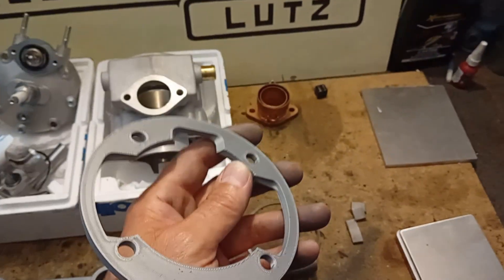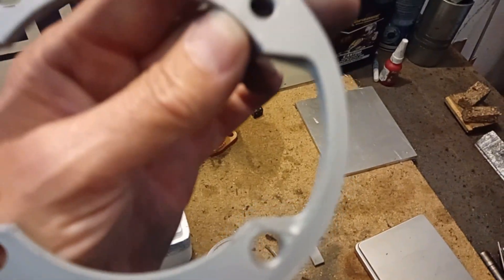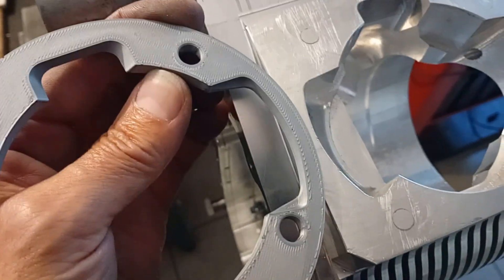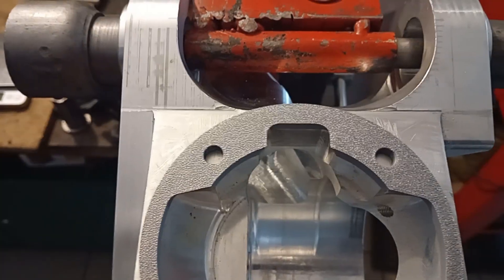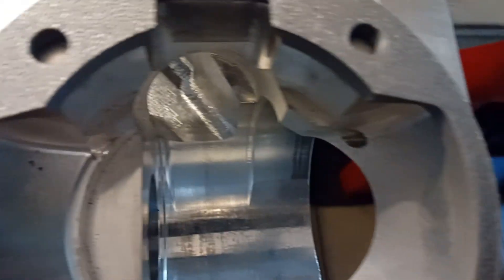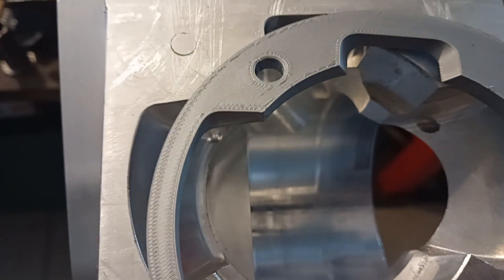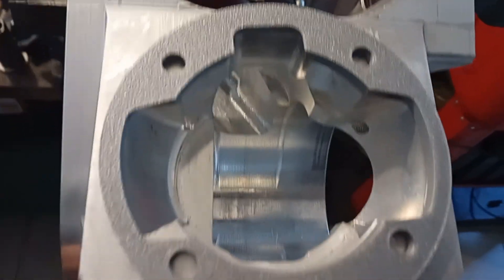Let me show you how it all looks, because the interesting part is if you look closer at the case. The case opening is different from the TOR. By having this flange, I can also use it as an adapter — the large boost ports area gets narrower, and the transfer ports transition to the different shape over this 5mm. That will be enough to have a nice flow without any modification to the case.